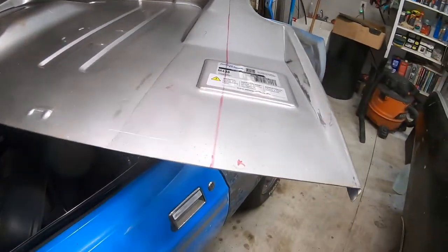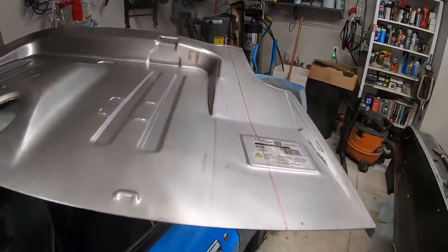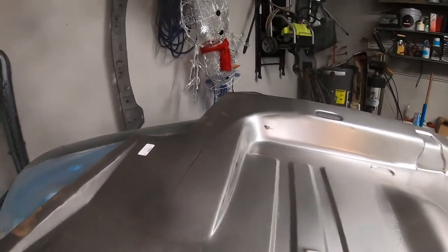See the red line? This is how I'm going to install it. I'm going to cut it there and also cut it there. The reason I'm cutting on those red lines is because the opening for the trunk is 42 inches wide, and that pan is much wider than that. I went on the Facebook forums for these big nose Mustangs — 71 to 73.